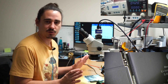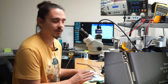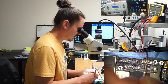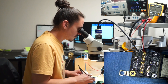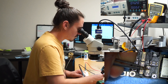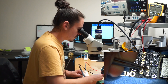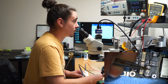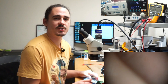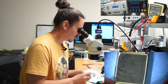I've done as much as I can with just the screen taken off, so I'm going to go ahead and remove this motherboard out of the housing and we can diagnose it further. With the motherboard out of the housing I want to make sure I still have the same behavior — and it looks like I do. So I still want to go off the assumption that I have a bad power rail, so I'm going to expose the area around the PMIC and start checking those lines.